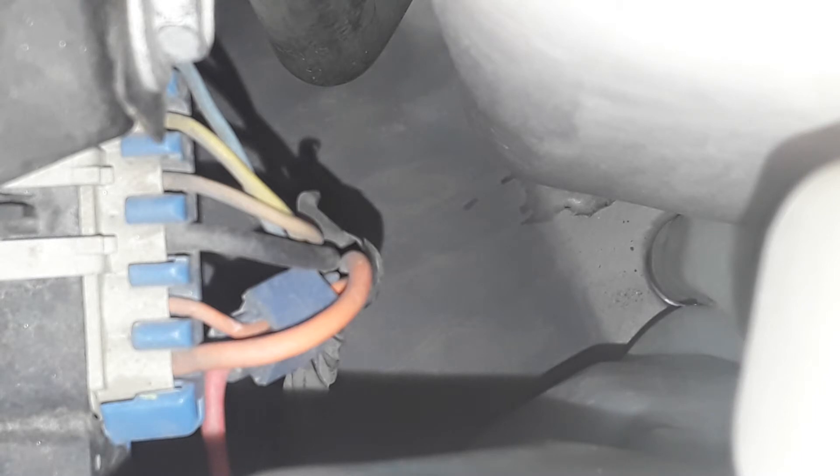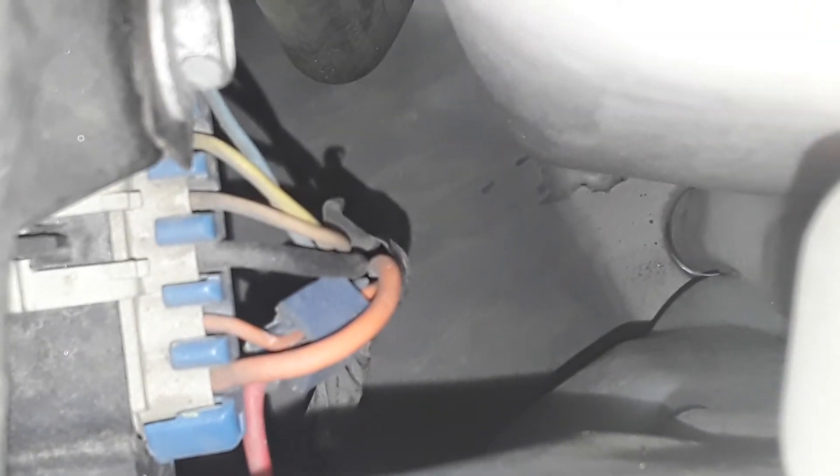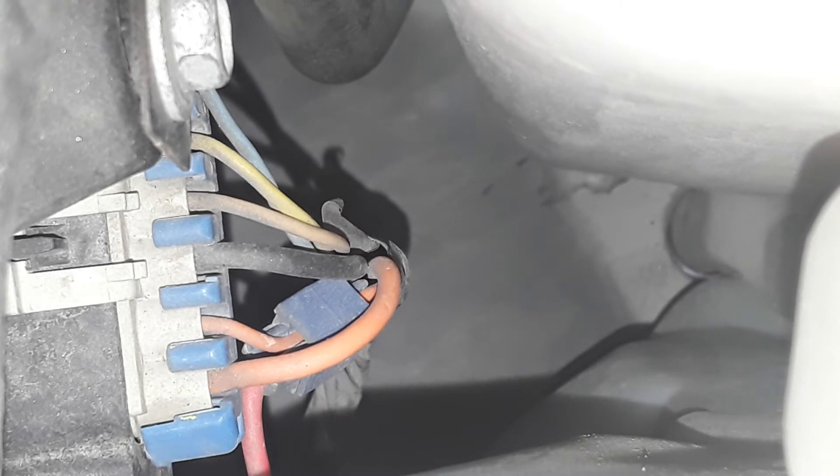So you've got the yellow wire there — I can almost see them here with the light in the way. You've got a yellow wire, a bluish wire, I think that's a black wire with an orange tracer, and another wire. Those are your various speeds. The high speed is that big orange wire going into that connector — that goes directly to the blower without going through a resistor bank.